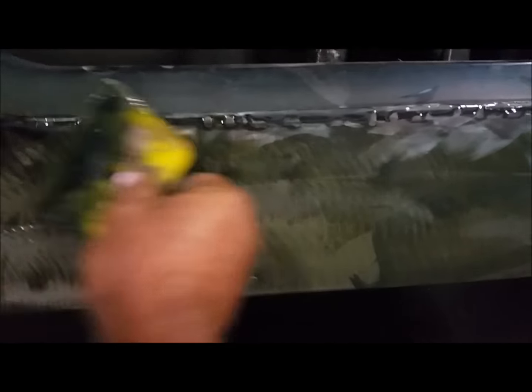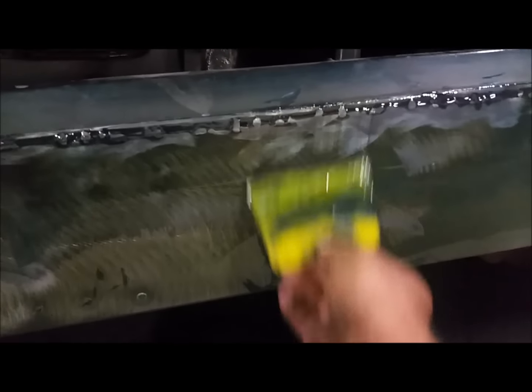I'm smearing it over all these welds. Now I was going to actually take a little bit of time and talk to you about the welds and how to cover them up. Because we're going to have to talk about the welds now that I'm kind of covering them, but you can still see them. There's a tack weld about every inch or less on here. The right way to do this, guys — welding — it should be seamless. It shouldn't be a bunch of tacks.